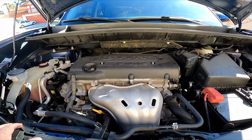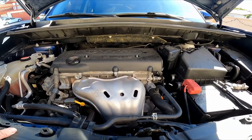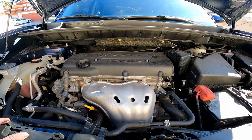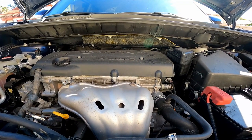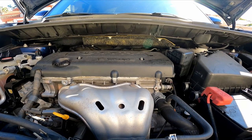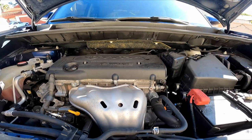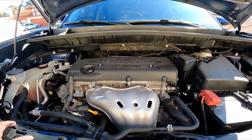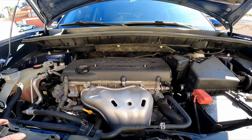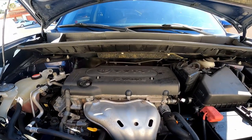We'll chalk the back wheels, get those bolts out, and get these struts off. Now I bought the unassembled struts, so I have to put the original springs on the new struts. It's not hard — I could have bought pre-assembled struts where all you do is bolt them in, but I saved a little money and went for maybe a bit better quality strut.